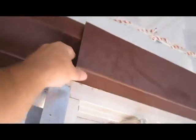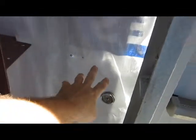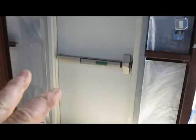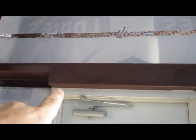One thing is the little metal bar — it went all the way across so I had to cut out the door opening and re-drill some holes so I can mount it. I've got my header panel sitting here which ties into that beam. Right now I'm working on this piece here — that's what it looks like when it's cut and done and installed. I got the bolts loose so I can tweak everything. I'm going to finish this piece of metal, turn the brackets around, mark and drill the header piece, and get everything loosely bolted together before I go outside and work on the J-trim.